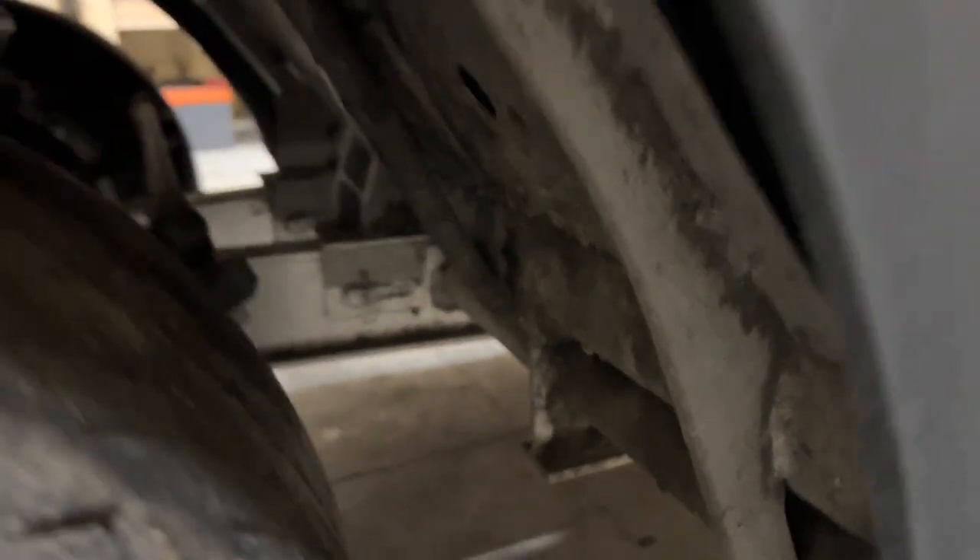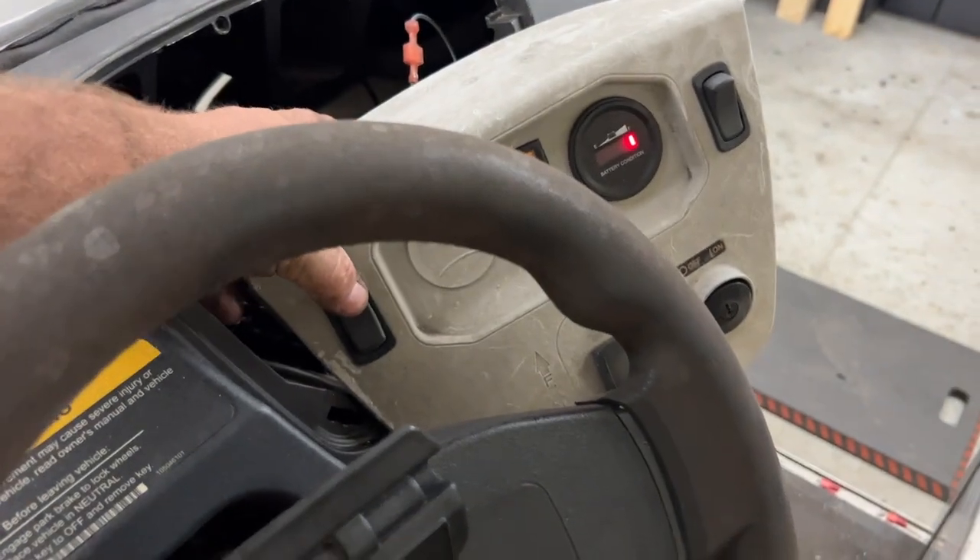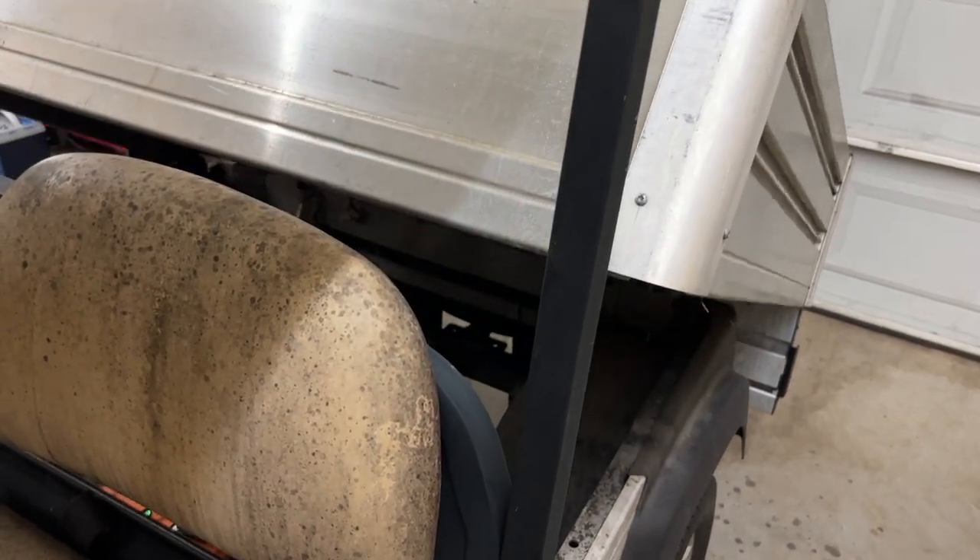I traced the wire from the dash switch and it's going down toward the passenger side wheel. I believe this cable runs to the actuator going underneath the vehicle — I completely overlooked it. There's a positive wire and a ground wire. Moment of truth: I put an EnjoyBot 12-volt in there and hooked it up. I haven't tried it yet, so I don't know if it works.